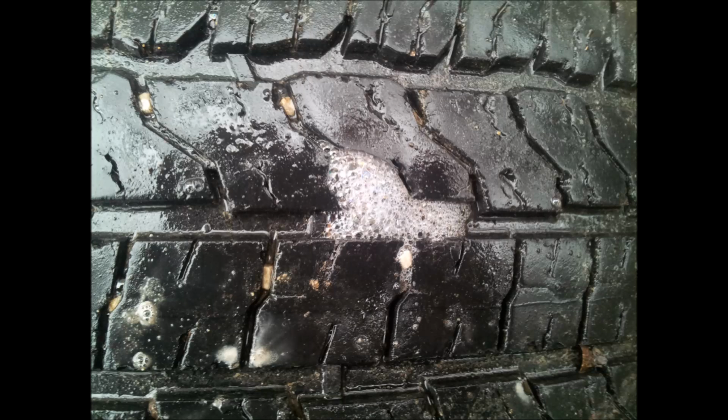But anyway, I aired the tire up, and then you get some soapy water, and you just start pouring it on the tire and you start looking for the bubbles. You're always worried that you're going to miss the bubbling, but no, it shows right up. I mean, you pick it up almost instantly. And sure enough, I found the hole, and you get the tire repair kit.